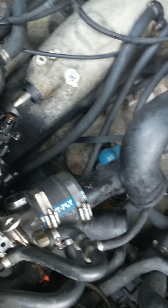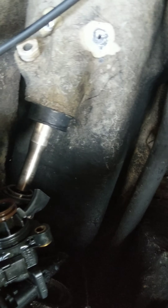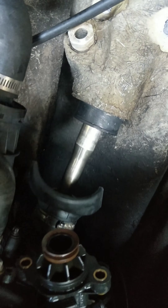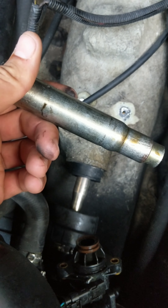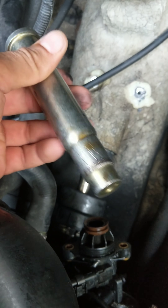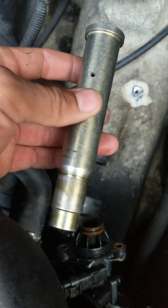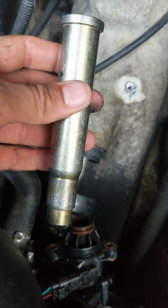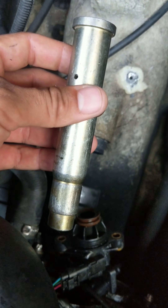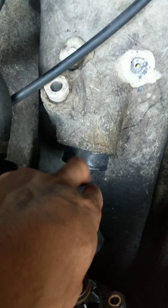The alignment tool has a second piece that goes into your PTO. That second piece is right here. I've already removed this piece because I've already aligned the ski, but this part goes all the way to the back of your PTO. Your drive shaft bearing also slides into this — when you do this you want your drive shaft bearing on there.